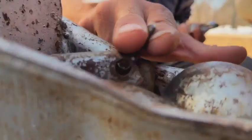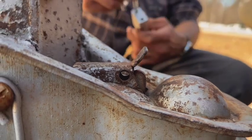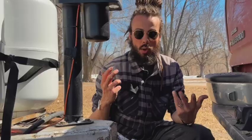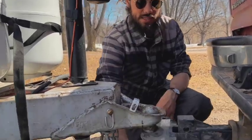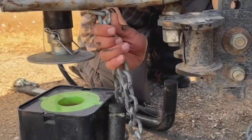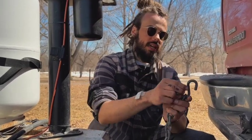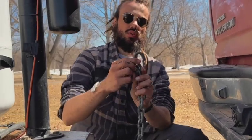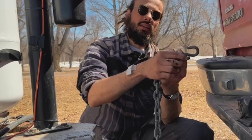While we're at the hitch, we can finish hooking up all the attachments. First are the extra security chains — they cross over each other, so the one on the right side comes over to the left. You'll notice the end of the chain has a hook. When you attach that to your vehicle, you want to hook it with the opening facing down, not up.